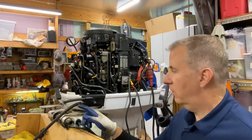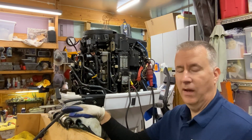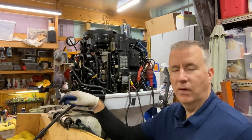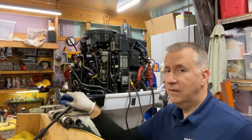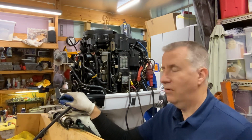As you look here closely, I capped off my oil line because I have oil mixed with my fuel, so I'm not concerned about running oil. I want to keep it capped so it can pull a little vacuum on it. A lot of guys like to disconnect the VRO from these. We'll get into that a little more when we do this test run.